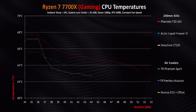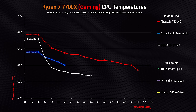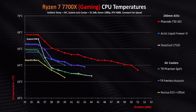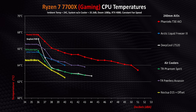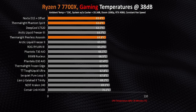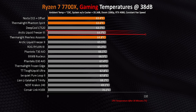The AMD results are the most straightforward. Starting with gaming, the best liquid cooler is the Arctic Liquid Freezer 3 at lower noise levels, while the LT520 really picks things up as RPM levels increase. The air coolers are all ultra-competitive, with the Peerless Assassin actually beating the T30 and eventually matching the Deepcool AIO. The D15 just creams everything. Against all the AIOs tested, the D15 can dominate, but it costs between $110 and $120 these days, making it more expensive than the Liquid Freezer 3 and LT520.